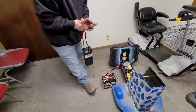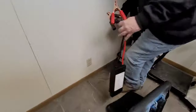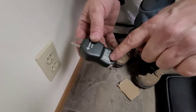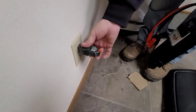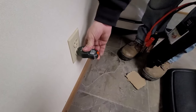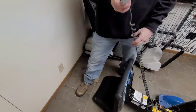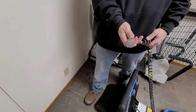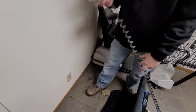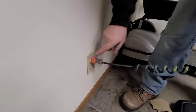We're going to do some testing on this Value Shopper Amigo. You always want to start off with the plug-in test. It gives you the readings up here — it tells you whatever lights up and what it means. This one says it's correct: middle on the right. The plug-in is good. Another thing with these Value Shoppers: Amigo started pushing out plugs where the plug lights up. Don't get confused — just because this lights up doesn't mean the cord is good. All it does is tell you that the socket is good.